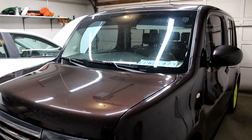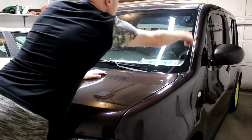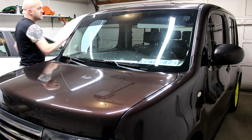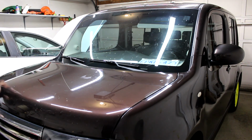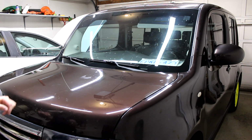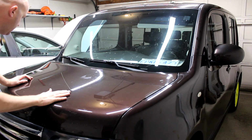And then what I'm going to do, so I'm going to do these little front bits. I did up there last night just to see how it came up. These little front bits of the fender, up this window pillar and across here. And then what I'm going to do is I'm going to buff it with the paint correction pads. I don't think the little touch-ups that I'm doing on the chips will hardly be noticeable then.